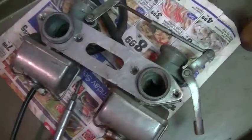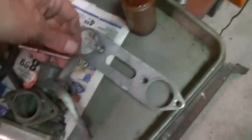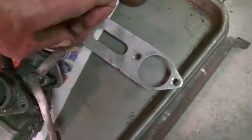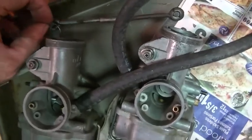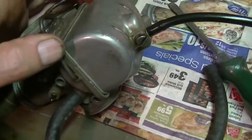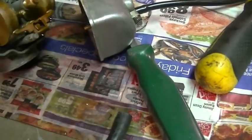My main focus today is cleaning these carburetors, probably for the hundredth time. First thing you've got to do is unscrew four screws to get them apart from this plate. Then there's usually a cotter pin in here — I just got a little piece of wire right now to pull the choke lever together. I'm going to take this off and start pulling them down. It just has this release spring to knock off and you can get the bowl off.